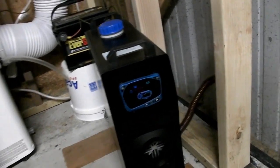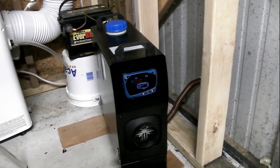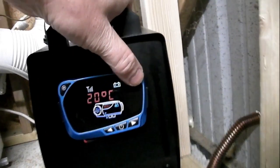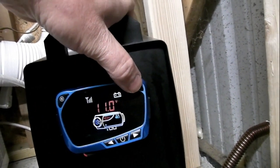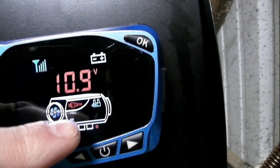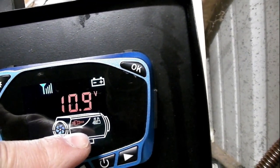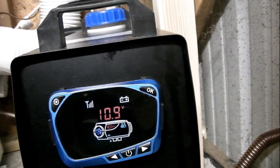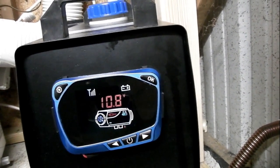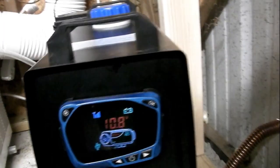If it just shuts off, it'll probably overheat and may melt something, which would be unsafe. I would think it has smart electronics to run a cool-down cycle when it senses the battery voltage is getting low — and it shows the battery voltage on this display here. Battery volts: 11. Right now the glow plug is running, so it's pulling a lot of amps out of the battery and drawing the voltage way down to 11 volts.